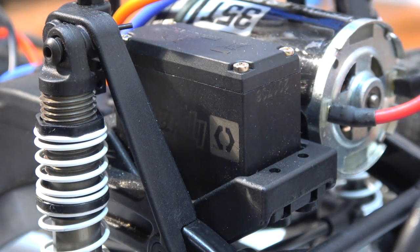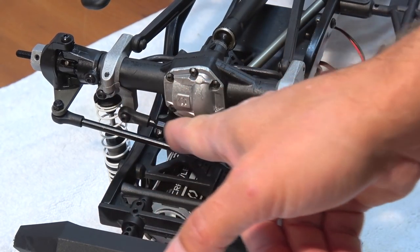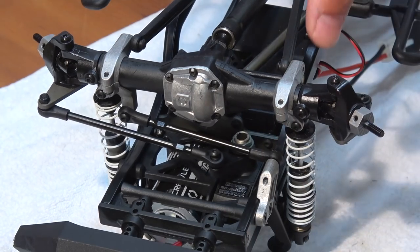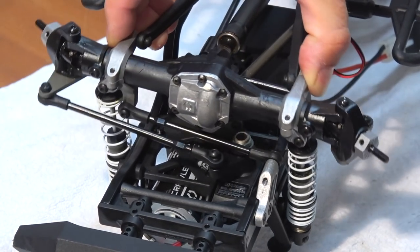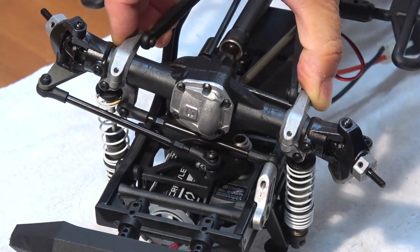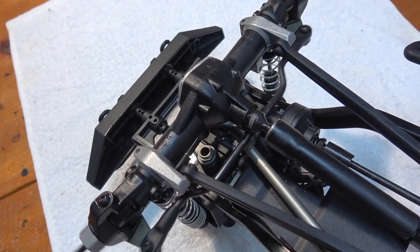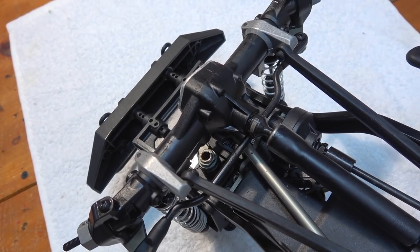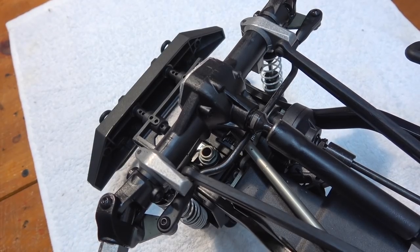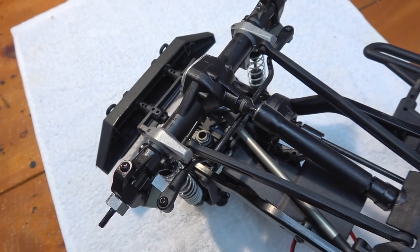The steering servo is installed on the chassis beside the motor over the front axle. The steering linkage works fine, and this Panhard bar provides a precise and stable steering control, also when the axle is moving over big obstacles. The steering linkage is installed behind the front axle, and so out of the way from rocks and roots on the ground, and it gives a nice scale appearance to the truck.